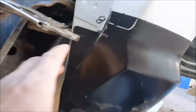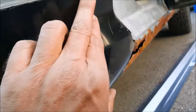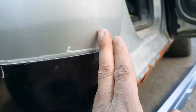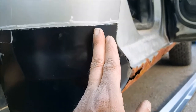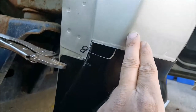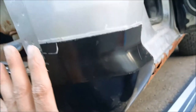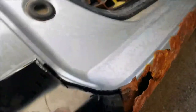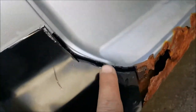I got this clamped in here, pretty much lined up, following my line around. This is the body line on the vehicle here, and this is the body line on the patch panel. Same thing going on over here. So everything basically has to come around the corner in order to close up this gap. This is where everything's supposed to meet up - where I measured to meet up was here in this radius line.